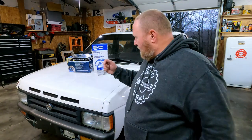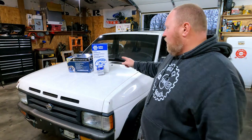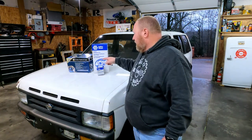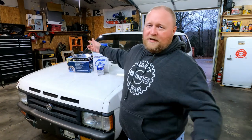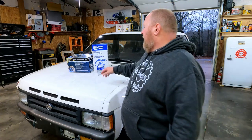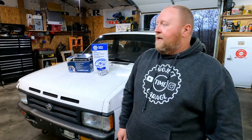Well, as promised, the next video on this Pathfinder is the major under the hood junk. So we've got a timing belt kit, which is the timing belt, tensioner, and another little spinny thing of some sort down there. Also got a water pump, because the water pump is right there at the timing belt. So if you're there, you may as well change it. And while we're that deep in it, we're also going to put a thermostat in this thing.